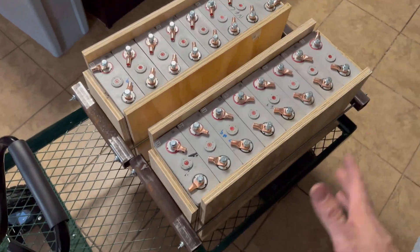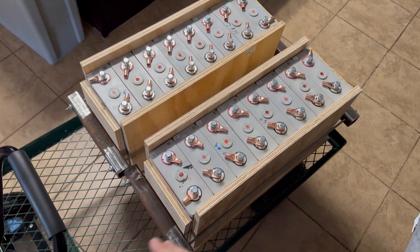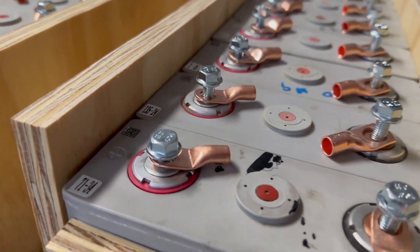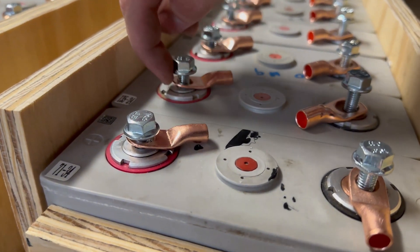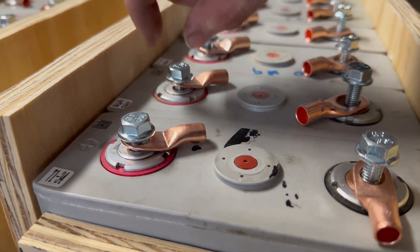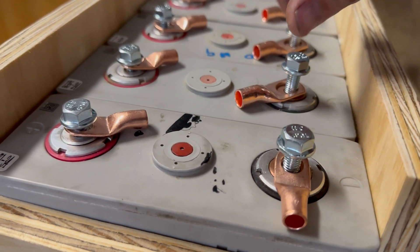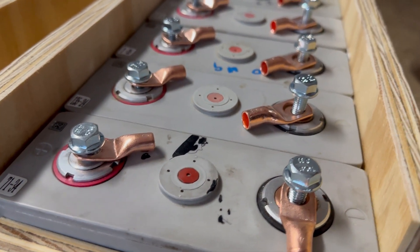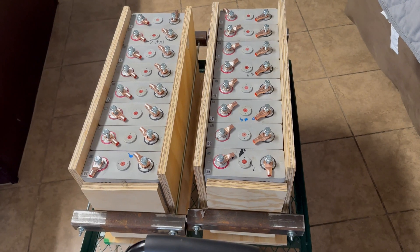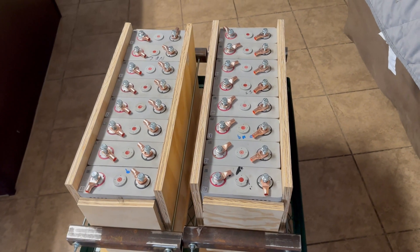I do still need to connect these two pieces because it's kind of flimsy right here. I'm going to put a cover and then put something over that so we can keep mounting more components. This is going to be the first step. I'm going to go ahead and pull the wire out and start stripping all my things. I do need to go get some washers because there's a lot of space between the terminal and the actual head of the bolt — still some wiggle room. Also, the thread holes in some of these have Loctite in them, so I need to go get something to run through and clean all the threads out. It should be pretty straightforward — it's just going to be a lot of work. I'll keep updating with little clips and snippets and keep showing you guys the progress.